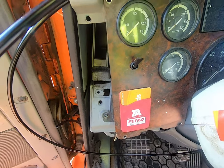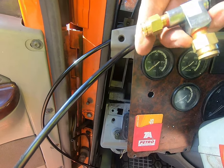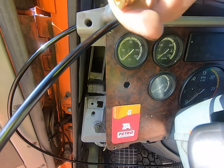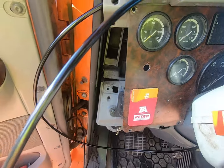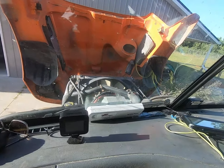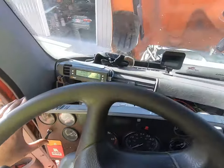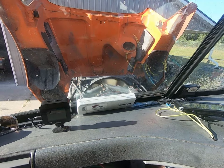I'm going to fasten this switch in here. On the toggle switch, this is the line in and this is the line out. I'll hook line in here and line out here. Now the moment of truth - you can see the fan is not running, it is spinning but that's just parasitic draw. I've got my switch down here, I'm going to flip it and let's see what happens. Bingo, it works! We'll switch it off and the fan shuts off.